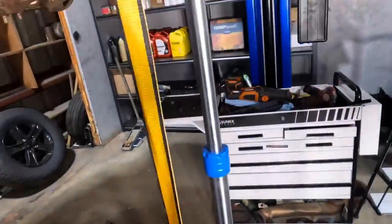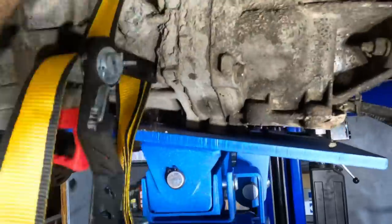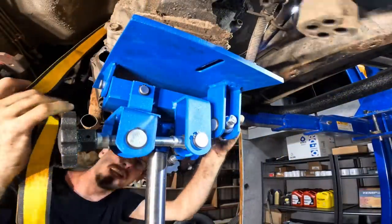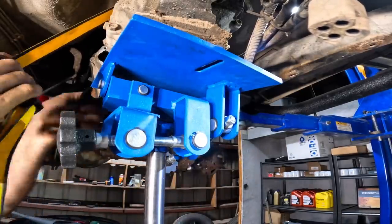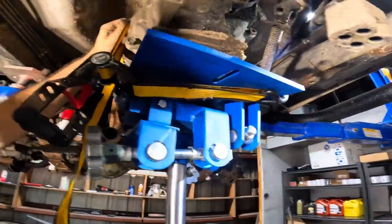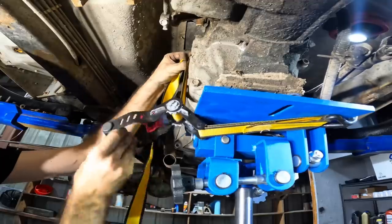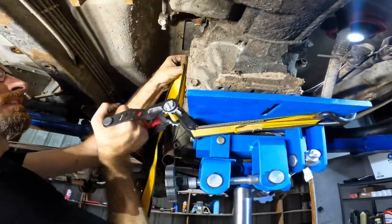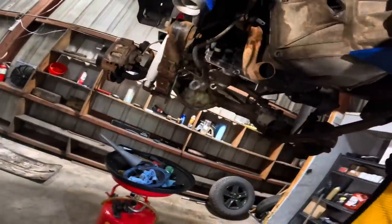It's pried apart. However, before we proceed, let's put a ratchet strap over this and strap the trans to the jack so it can't slide off and fall down — because if it slides, I can't catch it. Taking care to not get the wiring harness in here. We don't want to strap the wiring harness to it. We'll hook that one up over there and ratchet it tight. Wrapped it around and hooked on both sides so it makes more than one full wrap. And I'm just going to secure this to the jack. We've got one bolt on the other side and this bolt right here to remove, and then this thing should become free from the engine. We no longer need this high lift back here, but I'm going to bring it forward and put it under the oil pan just in case the engine wants to rock back.